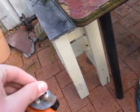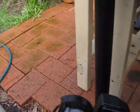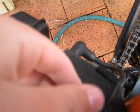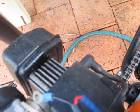The kill switch was just a switch mounted to the frame with two wires going down to the engine. It comes out here — this should be attached to that bolt to ground it. The positive goes to the small wire that comes out of the magneto and goes into the engine. When you switch it on, it grounds the wire, cuts the spark, and kills the engine.